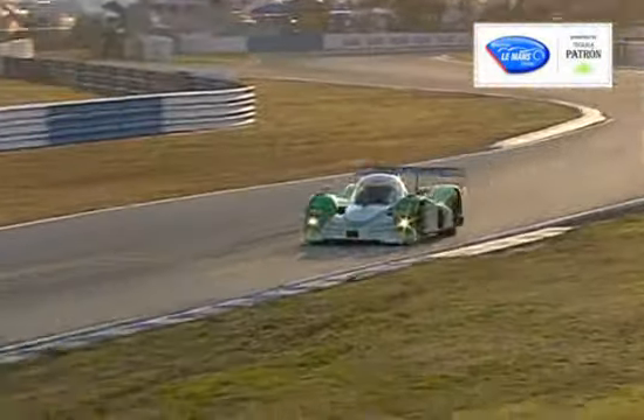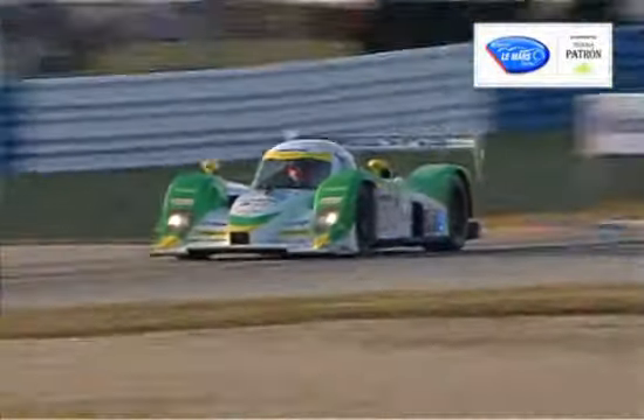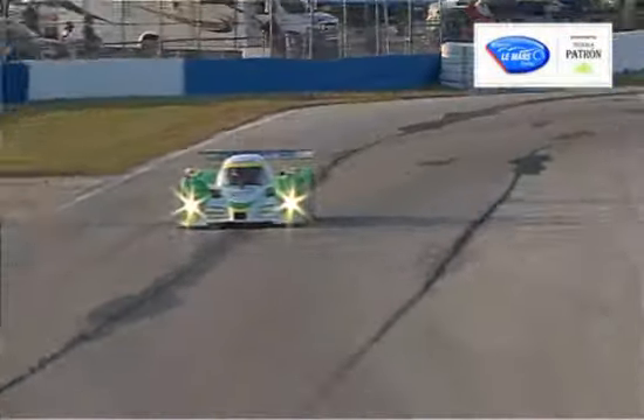A really good low height-sensitive car: you raise the front one, you need to raise the rear two. So if you can have a nice low height-sensitive car, you can actually run the car quite even on stiffness balance front to rear.